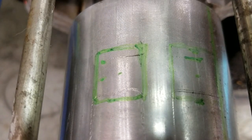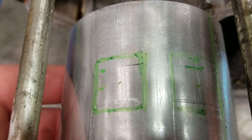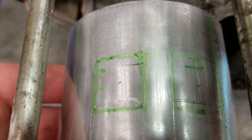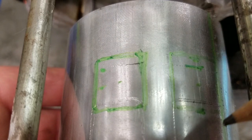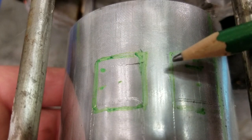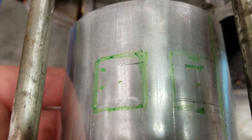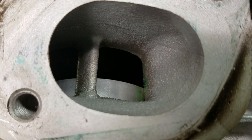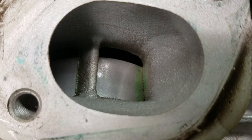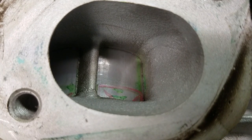Here we are with Matt's piston. This is really close up, but as you can see I measured my 28 millimeters up to center, then 8 millimeters up and 8 millimeters below, and then I have my sidelines which we scribed in a previous shot — that's where my windows are going to go. You can see the piston window is about to close where a normal piston-ported window would close, and then all of a sudden you can see that pink line showing up — that's where the new windows are going to start to open.